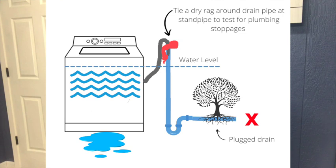With this particular instance, the customer would run a load, and a couple of days later call me saying her machine was leaking again. I couldn't figure out what was going on. Come to find out, every time it leaked was when she ran two loads of laundry — it wouldn't leak on the first one, it would leak on the second. What we discovered was that her drain line went through a separate line to a septic tank under some bushes, and the roots had grown into the pipe. It wouldn't allow the water to drain fast enough for two loads of laundry.